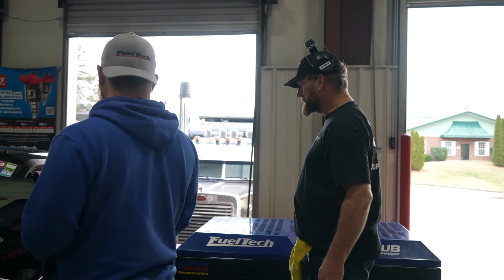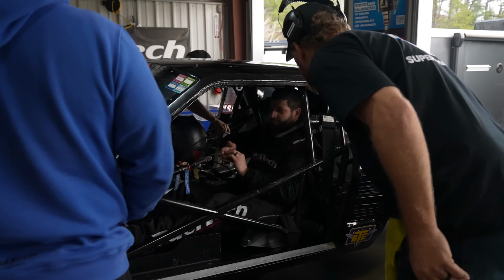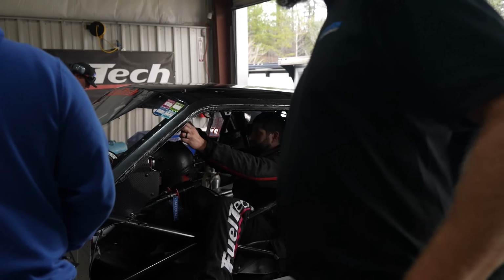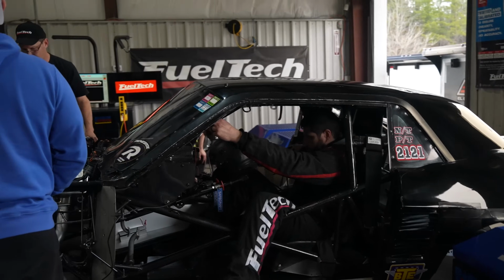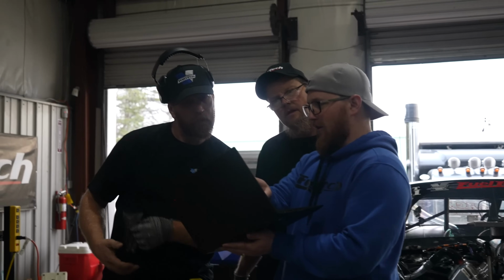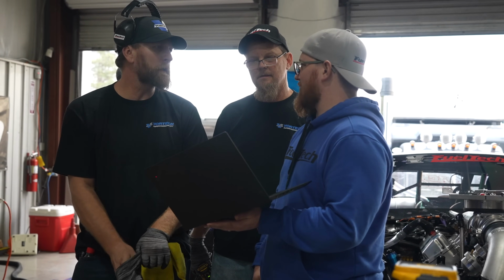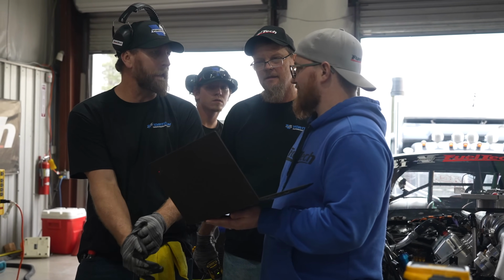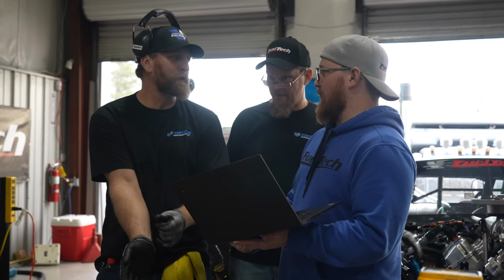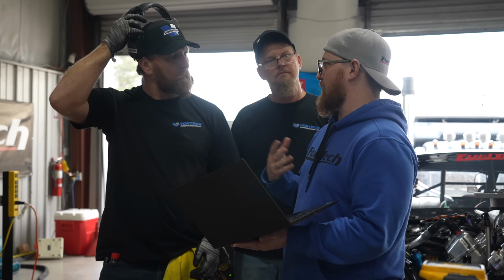No. After the shift, it stayed. We shift a second and stay at 75 for almost 2 seconds. Really? Hold on again. 3.7, but it always shows 2.5, 3.0. Is that because it's in the tube? Okay. So it's a bullshit number. It is because it's not getting a whole reading. It's over pressurizing the sensor, forcing the fumes through the sensor, and it makes it look richer than it actually is.